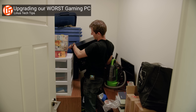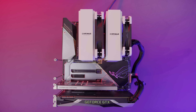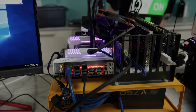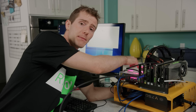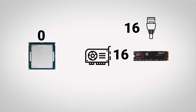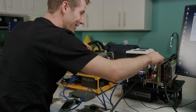With that in mind, we will not be using just your average gaming machine for our testing. On one side of our link, we've got Intel's flagship 18-core processor with a Rampage 6 Extreme motherboard and 128 gigs of RAM. In the other corner, we have a 16-core 7960X and an ASUS X299 Deluxe with the same amount of RAM, and of course RGB across the board. We're using the X299 platform with Core i9 processors because we need enough PCI Express lanes directly off the CPU — 44 lanes gives us 16 for networking, 16 for our quad NVMe storage devices, and some leftover for the graphics card. For NVMe storage, we have four Samsung 960 Pros on one machine and four Corsair MP500s on the other, both running in RAID 0.